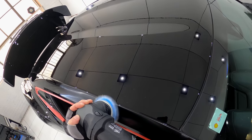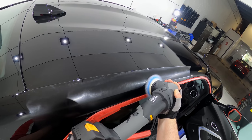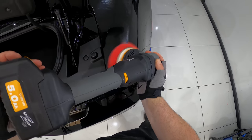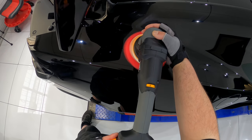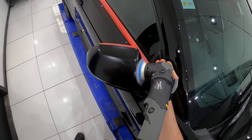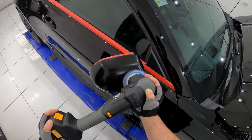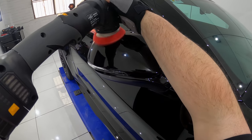Now in part 1, you guys also saw that the paint was suspiciously thick, averaging 300 microns and beyond, which definitely isn't common and almost points to this paint being scuffed up and painted over cheaply as a respray. But the paint was also very consistent with an OEM finish, so I didn't see any evidence that it had been resprayed, but if it did, it also means that whoever did it had to remove all the doors, bonnet, boot, and all the trims, as those door jams and all the areas around the plastic trims were finished to an OEM spec. So I don't know what to tell you guys other than this is original OEM paint, or someone, meaning the manufacturer or dealership, went to a lot of trouble and expense to repaint this car for some unknown reason to make it look like an OEM finish, which is horrible to think that they would do that and brings up the question why. In any case, I can't be certain either way, but I'd like to give them the benefit of the doubt.